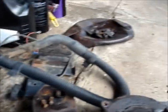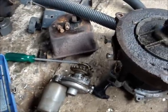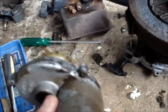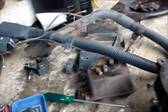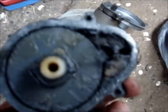Oh, here's all that's left of what was a lawnmower before. Some useful parts left, but anyway, I think I'll work out why the starter motor wasn't throwing out. Do need to oil everything inside it too, and put some grease on the gears. Anyway, pull it apart and see what's going on, then worry about this engine and everything else. The motor itself seems to work perfectly, but there's years of dried out old grease in here, so I'll clean that out. Get everything really good and put new grease on it. It's quite stiff to turn.